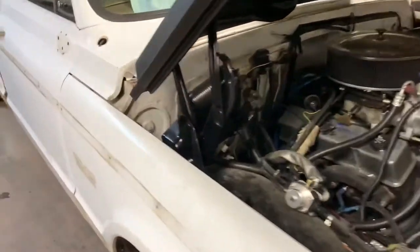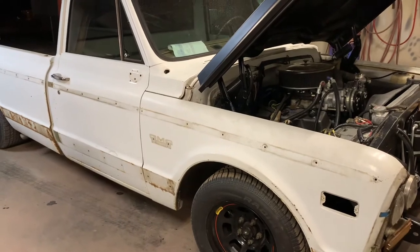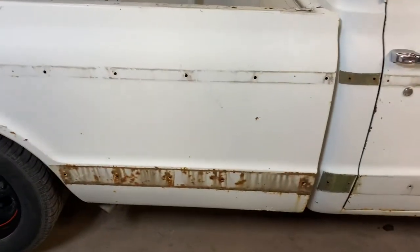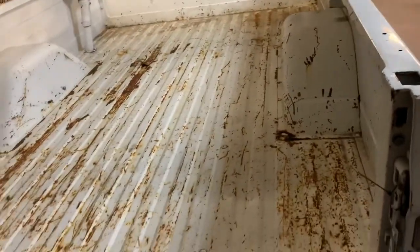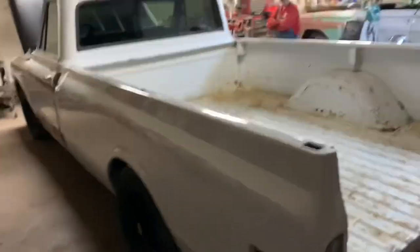Pretty cool truck — unusual to see one this solid in this part of Missouri. We're just going to be doing some body work and painting. Really not a whole lot to do here. We did get a cowl induction hood for it, which I think is pretty cool. This rocker is solid, but we've got about 700 trim holes to fill — not a big deal. It's got 295/50-15s on the back. It has a 700R4 four-speed overdrive transmission. I had that transmission built — it was in a car I had — I think it's got like a 2,800 stall.